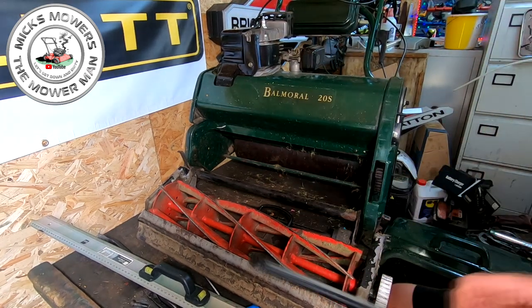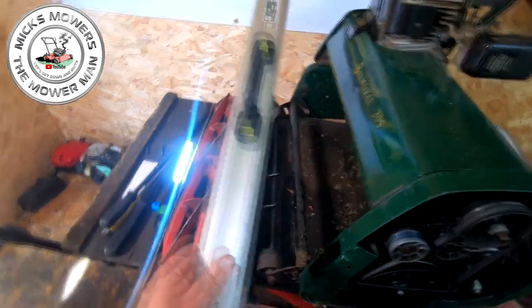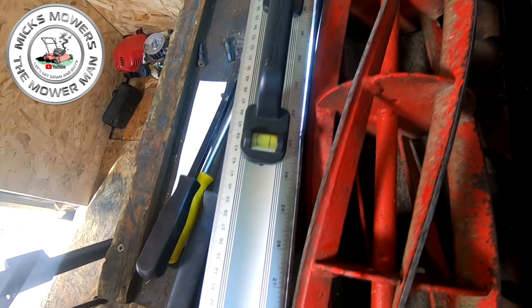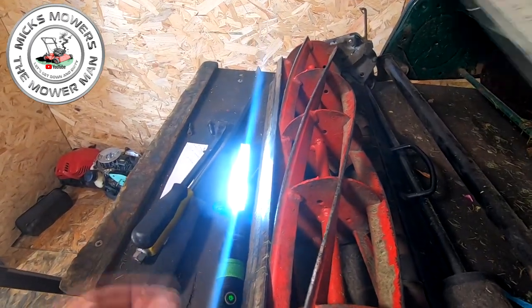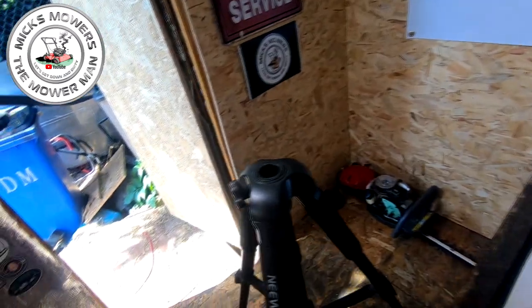You can actually see it's shocking. I'm going to put the light just behind here and put the bed knife up against this edge as tight as I can get it. Right - so you can actually see daylight through there. Not here, but all the way up here - look at the gap. So this bed knife has actually got a dink in it and I think the dink is right there. There it is. So there's a dink in the bed knife - it's actually got a dent in it. Not quite sure the reason why but we can rescue it. Hopefully the cylinder's still good.